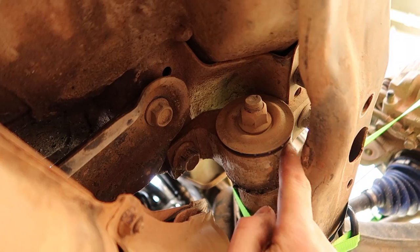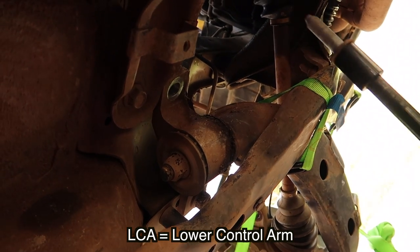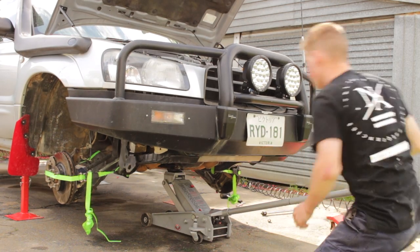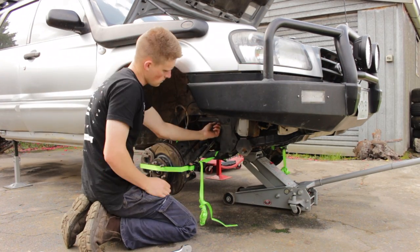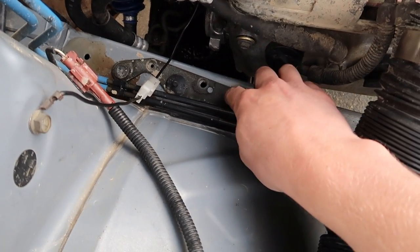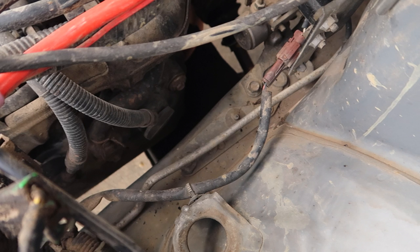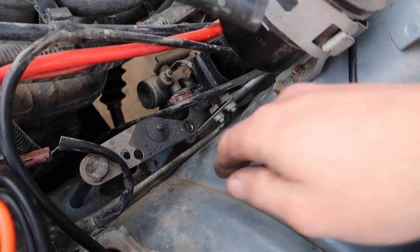Loosen the lower control arm bush nuts and remove the LCA bolts. From here you want to get to the trolley jack and support the engine. Once the engine is supported, you can remove the engine cross member bolts. There are two nuts that can be loosened from the wheel well and the bolts themselves are secured on the bracket. These brackets are found next to the ABS box on the driver side and underneath the washer bottle on the passenger side. These are also held in by screws which you will have to remove. I find the passenger side quite tricky to remove as there is a solid line above it, however the line is quite soft and easy to bend out of the way. You will also want to remove the three bolts from the cruise control box on the strut tower as this will be in your way.